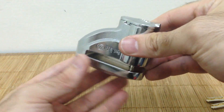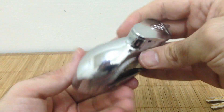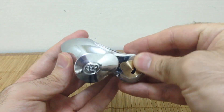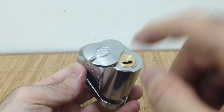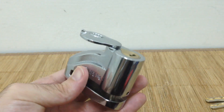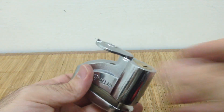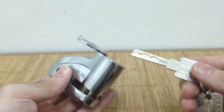Here's the motorcycle disc brake lock version. It has a very important difference from the padlock. It weighs around 550 grams, has a sleek shiny design, around a 60mm throat depth, and a 6mm gap height — fitting most motorcycles fine. There's a rotating weather cover to protect from mud, dirt, and rain. However, this version is not the 360-degree spinning version. Here are the two cores side by side for comparison — this disc lock will tension just like any other lock with an incorrect key, so please be aware not all 750 series Uema locks will spin even though they have a very similar-looking core and key.